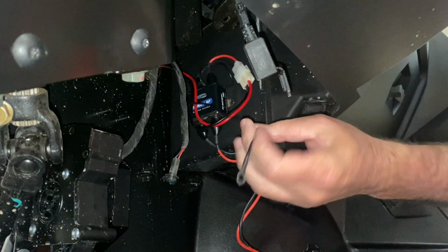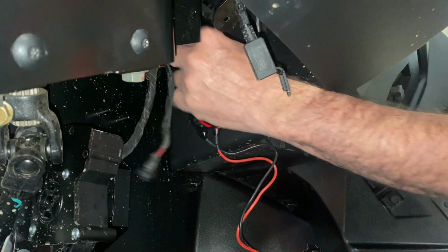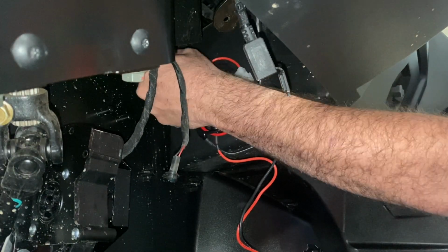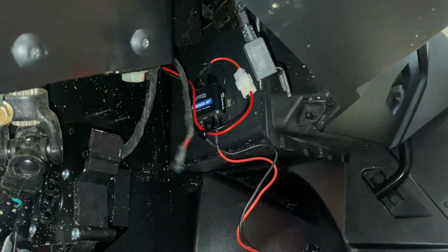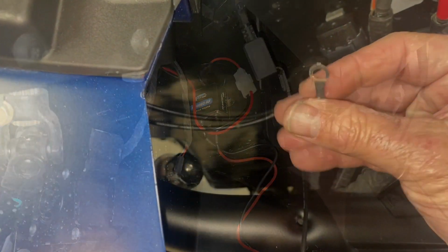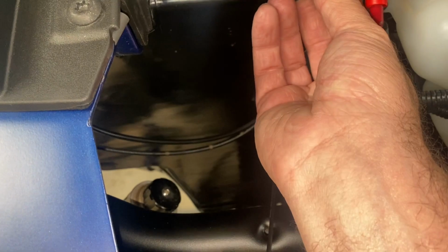There is a ground cable there that you're going to want to fish through the bulkhead, the grommet, and we can attach it to the ground post up on that bus bar on the firewall. We'll attach that when we get the radio and intercom ground strap run there as well.